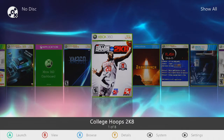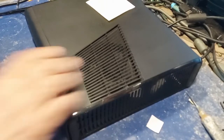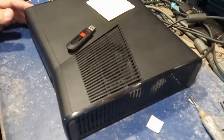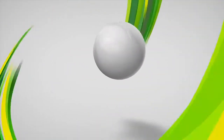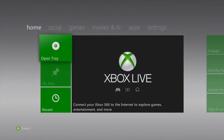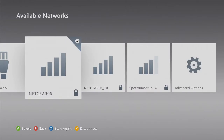So you've got to get it up on your network for the first time. The first thing you do when you get this console — before you plug the USB in — power on the console. It should boot and go right to the original dashboard. When you get to the original dashboard, you go to Settings, then System, then Network Settings. Your Wi-Fi is going to come up — click on it, put your password in. When you do that, it's going to automatically test the Xbox Live connection. You're going to get a check mark and two red Xs.